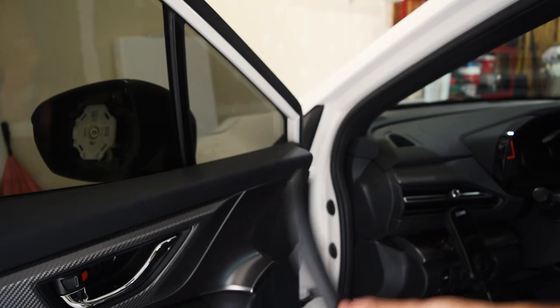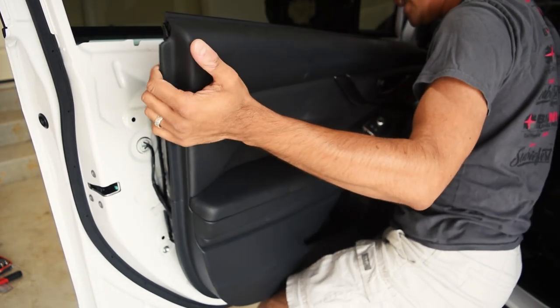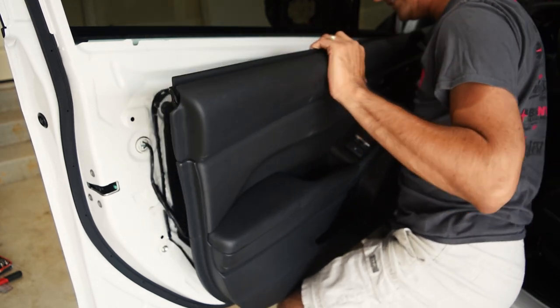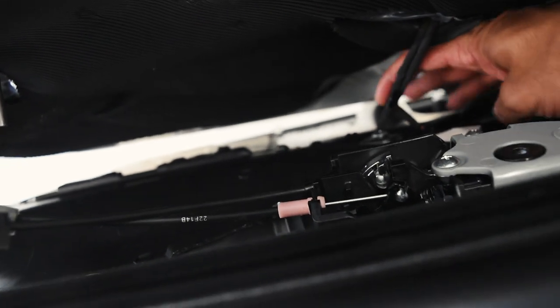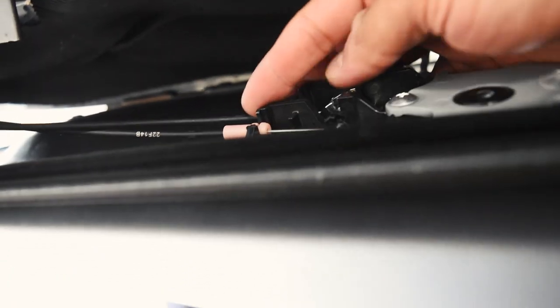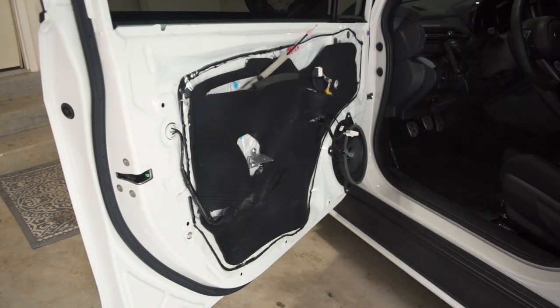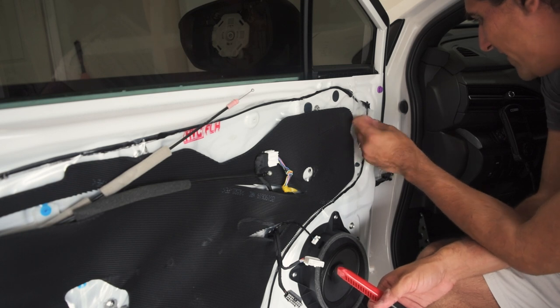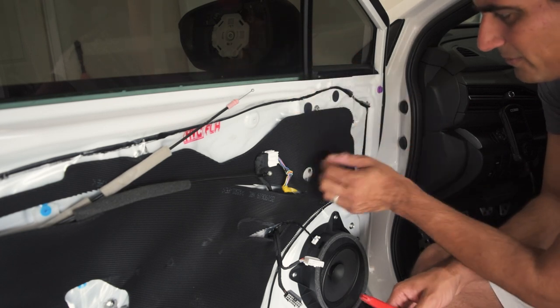So it comes up. Now there's obviously going to be a couple of things behind this. Here is the stuff for the door and the lock — this needs to come off. And then down below, you see these cables here are also plugged in. This is connected to the window or the mirror itself, so that's going to have to come off. There's two clips down there and two plugs up here that need to be removed so this whole thing can come off. Door's off. Here's the goopy part they were referring to — this has to come off and we've got to be careful with this gummy stuff because the area we need to get to is right behind here, and that's what's holding the mirror cap on — this we're actually going to have to unplug as well.